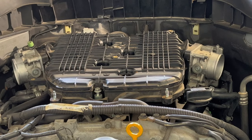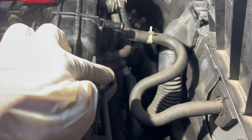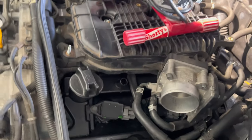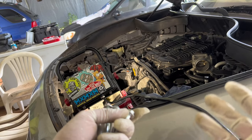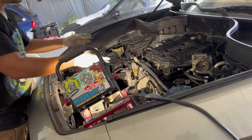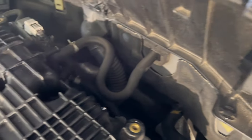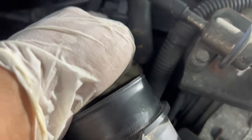In the back side I'm going to remove this connector — that's the evap line. There's also this one and that one to remove. This one might be a coolant line so when you take it out you will have some coolant leak, as well as this other one. All in all, to remove this intake manifold it's those bolts we removed. When I try to lift it, you can see which is snagging and holding it down. There's a coolant line as well as the back one, and one that connects and goes all the way around. I'm trying to get that one loose.